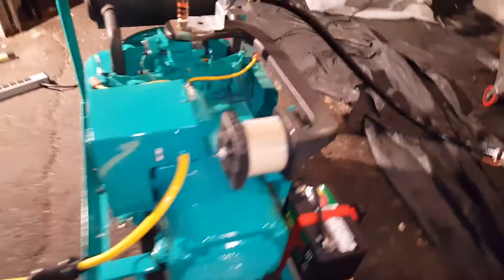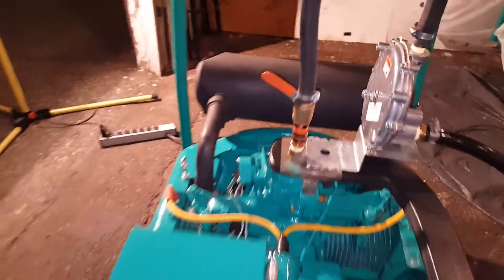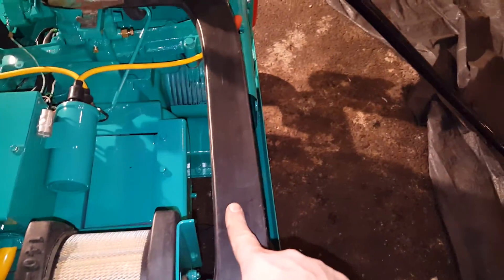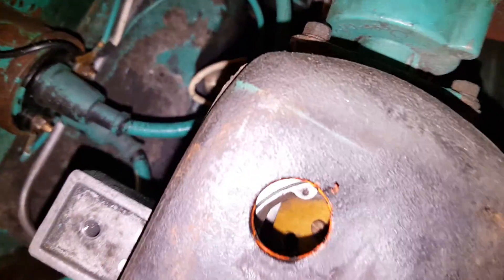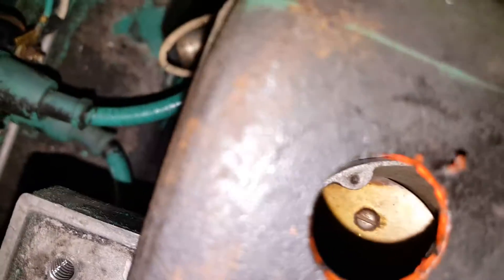Again, running propane — I was able to reach full capacity on this 6.5 NH. It's a gasoline model with a Mikuni carburetor. The only thing we did was throw this contraption on that I whipped up in my garage. The only modification was to drill a hole in the tube here — you see that hole down in there? That's the choke; it has to be drilled in the right spot.